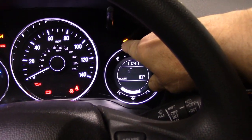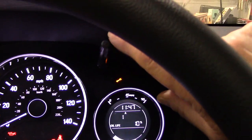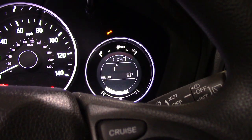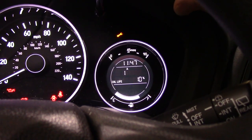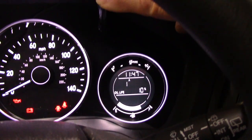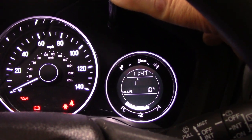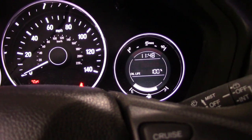Before we let this car go, we have to go inside and reset the oil maintenance reminder light. Frequently when you go to oil change places or even dealerships, they forget to reset the oil life. As you can see the oil wrench light is on and the oil life is at 10 percent. To reset it on this vehicle, press and hold the trip reset button, turn the key to the on position with the vehicle not running. Hold it about 10 to 15 seconds — the dashboard will start to flash. Take your finger off the button, reapply it and hold it again, and it resets to 100 percent.